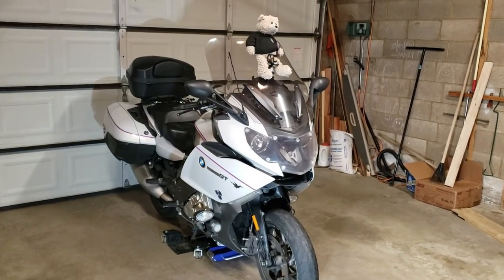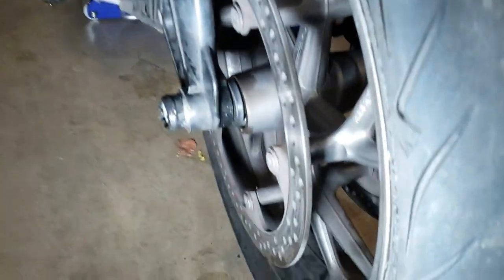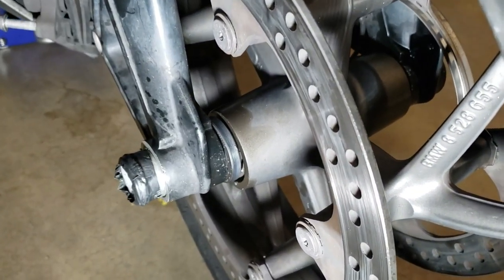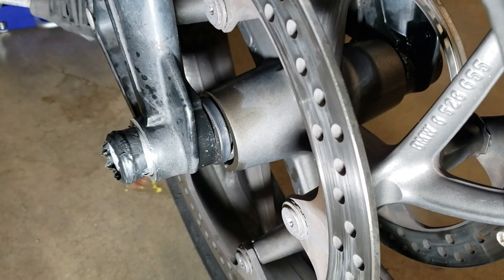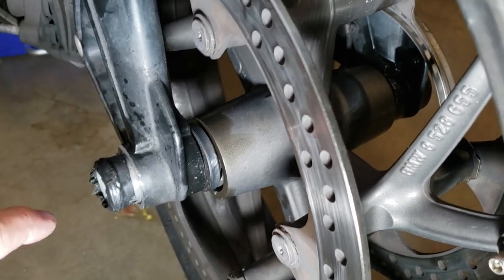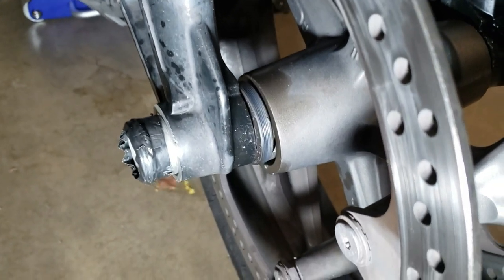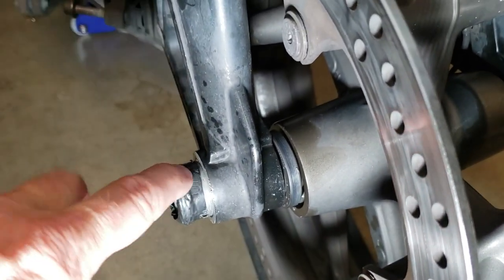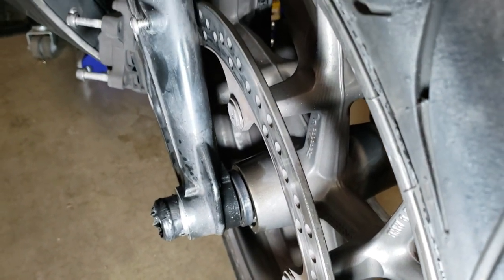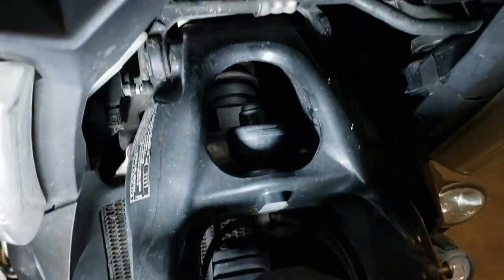We are back on day two of our front wheel bearing debacle. This wheel bearing came apart, and apparently the bearing has welded itself to the axle shaft, so I can't get it out. The threads are okay and the other bearing appears to be in good shape since the dust boot is still in place. But regardless of how hard I try, I have not been able to get this shaft to slide out to get the wheel off. The next step is going to be to take the entire front A-arm off and take it to a shop.